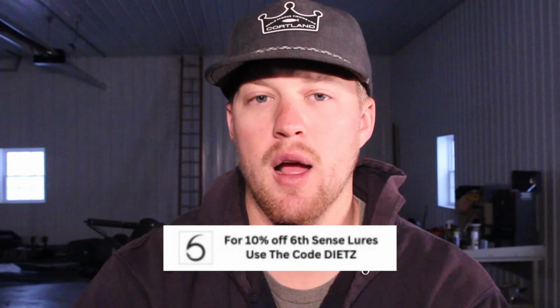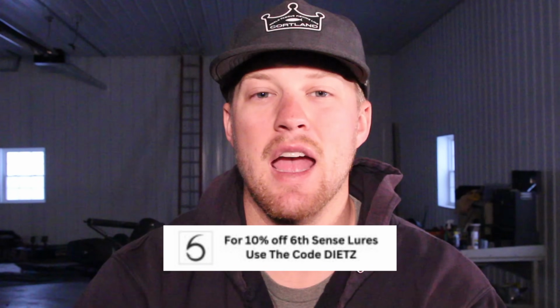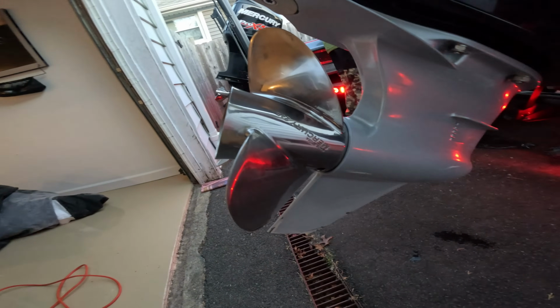Just making sure the motor is warmed up, everything's functioning as properly as it can, making sure my impeller is working, making sure my motor is peeing, because sometimes the holes on the back of the motor can freeze up. And if that happens, you really just need to make sure it warms up properly. Because if that impeller freezes up and you try to run too fast, your motor will overheat, you'll strip the impeller. Something bad is going to happen if you try to run it too soon. Especially if your gearbox had a little bit of water in it, it was kind of frozen. If you try to go right away, that's going to cause some resistance and you're going to blow your lower unit, which is what we don't want you to do. So letting your motor warm up an appropriate amount of time, 10-15 minutes, is mandatory this time of year.